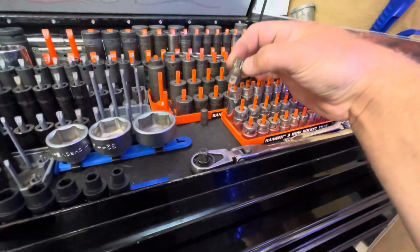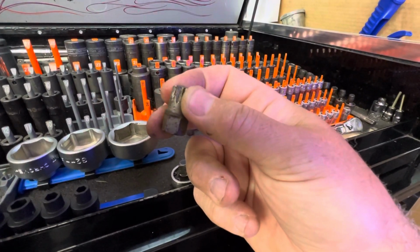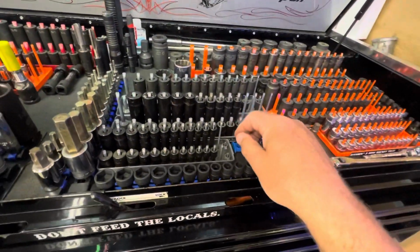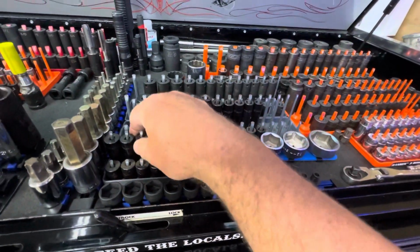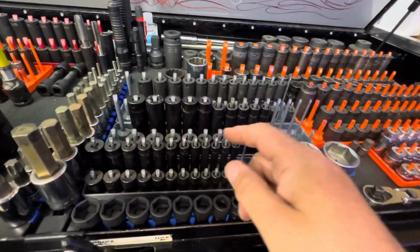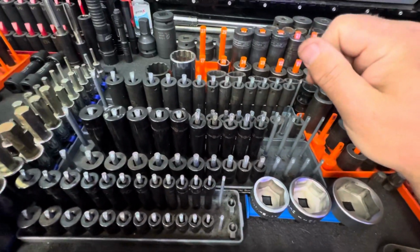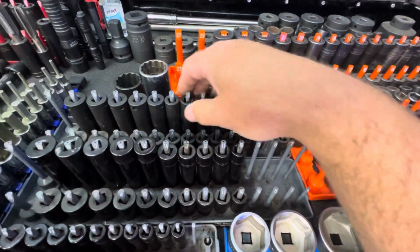Small triple square for getting into bell housing bolts. These were made when the Tiptronic transmissions came out in the Mark IV Volkswagens. Gear wrench oil filter set, some 1/4 inch drive Matco spline style sockets for rounded over fasteners. They're from 5 to 15mm, shallow and deep, 1/4 inch drive, and the same style socket in 3/8 from 10 to 19mm. In back of them, 3/8 drive Matco ADV line.